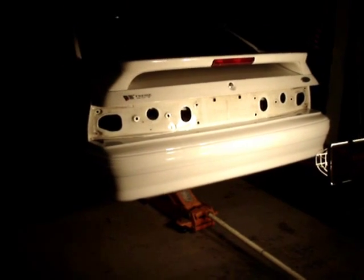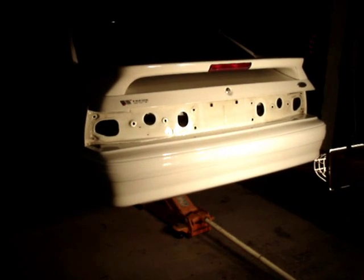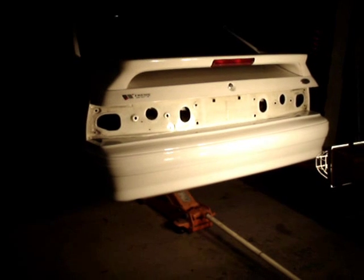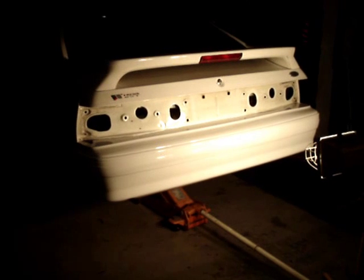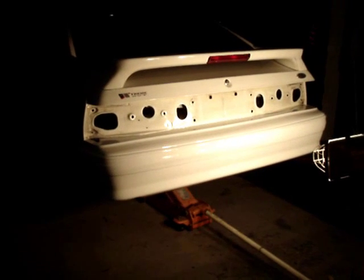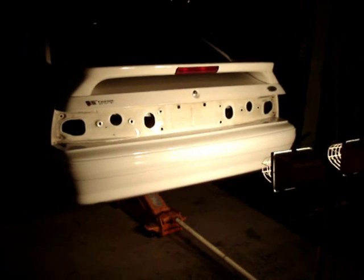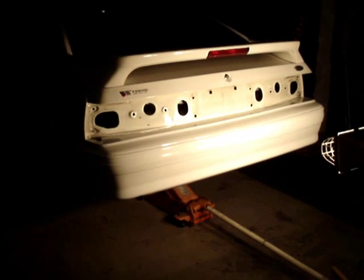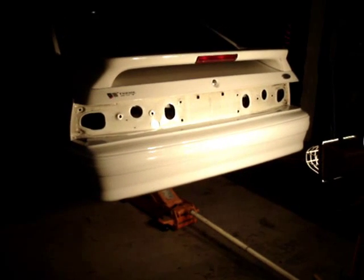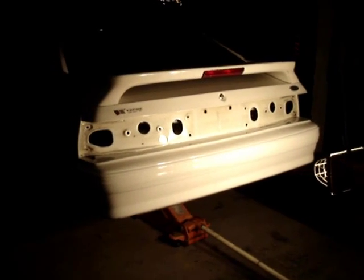When you're doing these bumpers, I'll tell you — even when they're brand new parts, you better sand them good. I sanded it down, put an etching primer on there to etch into the plastic, and it still didn't stick. So I ended up sanding the whole thing with 180 grit. I don't normally believe in sanding plastic with 180, but I sanded it with 180, primed it again, and scuffed it down. I didn't think it would work, but it'll definitely bond now.